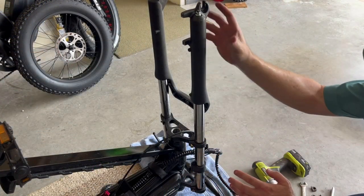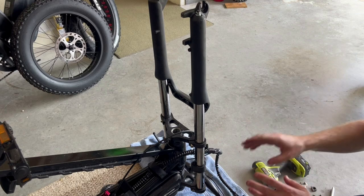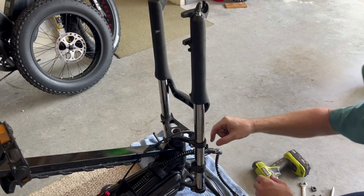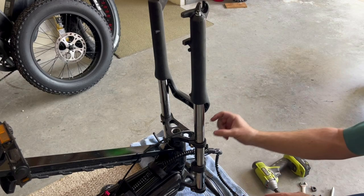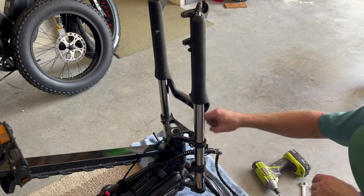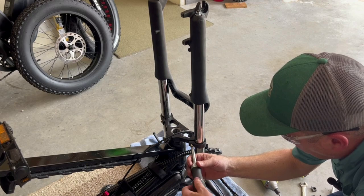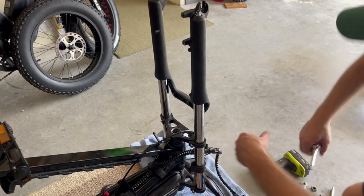I've come up with a creative way to remove the fork from the bike without having to remove the steering stem and handlebars. I'm simply going to remove the shock legs while retaining the upper and lower crowns on the bike, then put the new ones in. This only works because the stock legs are 32 millimeters and the shock I specced out is also 32 millimeters. I did order some other shocks once that were 34 millimeters and really had to take everything apart and add a handlebar extender, because these crowns have unique spacers making a taller steering tube than you typically get on aftermarket shocks. So I'm going to loosen all four bolts here and slide out the factory shock, then slide in the new one.